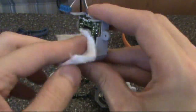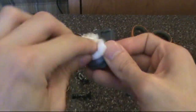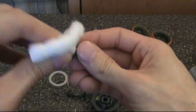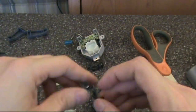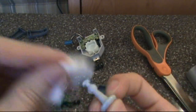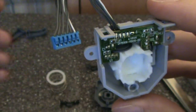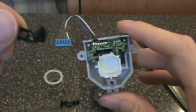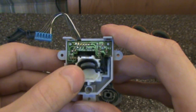Once it's all cleaned, we can now see how exactly the control stick works. This functions in a much different way from any other modern control stick. Those use a device called a potentiometer to determine location and movement. The Nintendo 64 actually works much more like a traditional computer mouse. The horizontal and vertical bars attach to both the control stick and a gear on each side. As the stick moves, it turns the gears for LEDs, which track movement using a shutter effect and give out a digital reading of position back to the controller — which means the analog stick isn't technically analog at all.